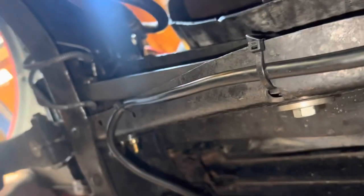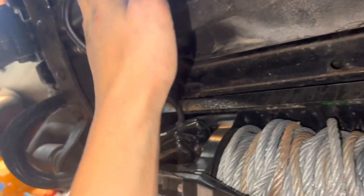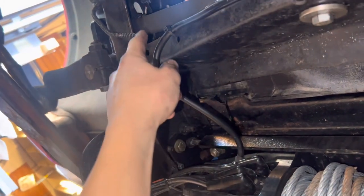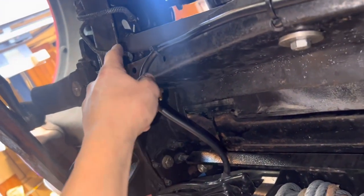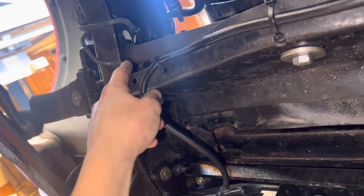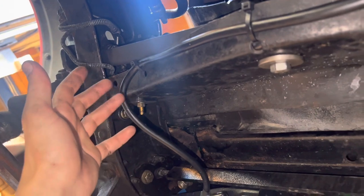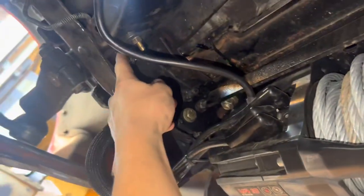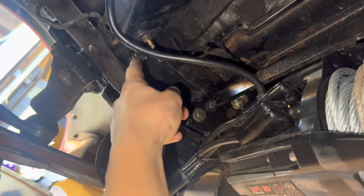There's the back of that bracket in there — big machine washer inside. Overall, pretty happy with it. I didn't have to put the spacers on it because my frame is a '72 and it has a different style frame. For the other style frame, you just have to put two or three washers on the bottom and that's it — that would be perfect for you. Honestly, this little bracket up here I think does a lot of work already.